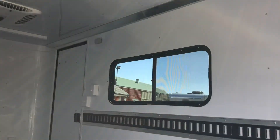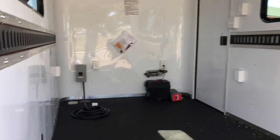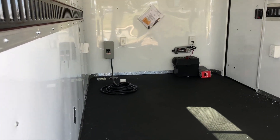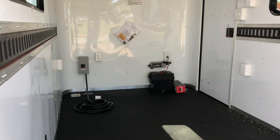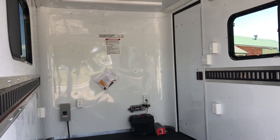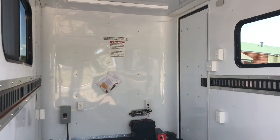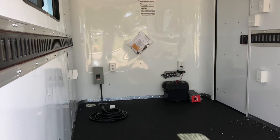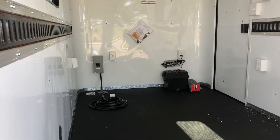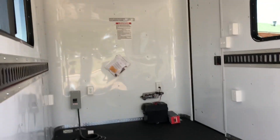It's going to run your little puck lights and your exterior lighting for you without having to be plugged into your vehicle. And then right there to the left of it is your 30-amp box with that cord. You guys take that cord, pop it right through the floor, and you can plug into your generator or the campground or an extension cord — however you want to power up the trailer. Once you've got that going, that's going to turn on all of your interior outlets, so you guys can see you've got four interior outlets right there, plus that exterior GFI on the outside.